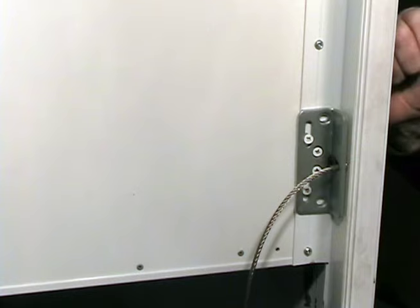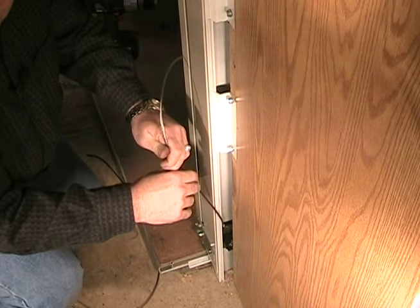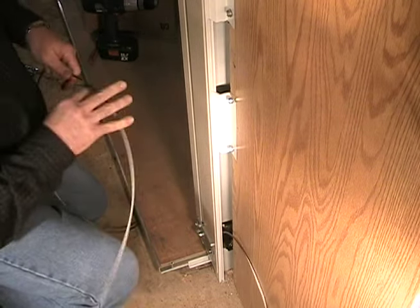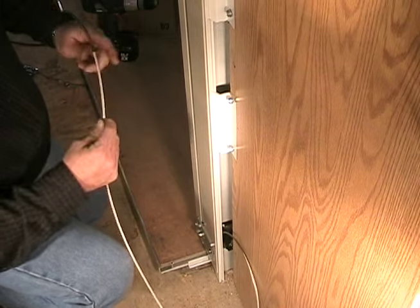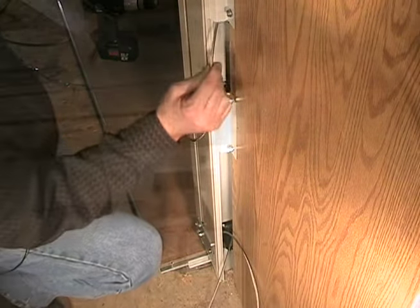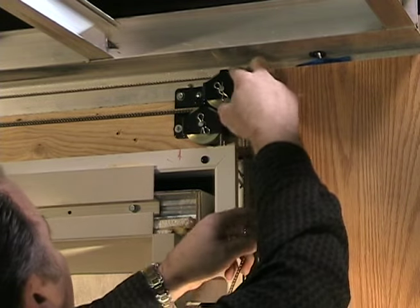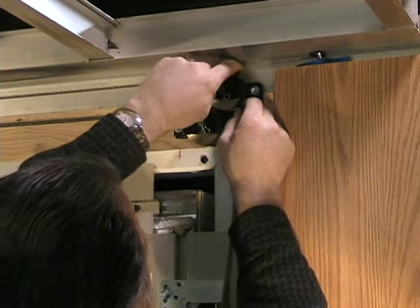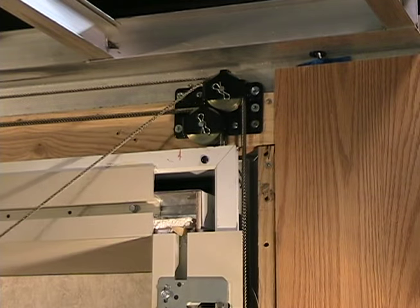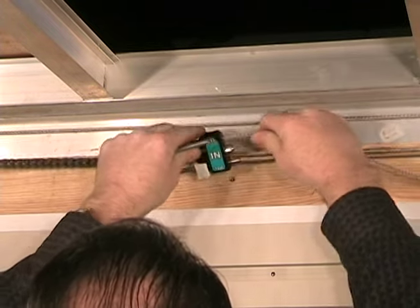Now I'm ready to go inside the coach and pull the cable through. Pull the cable until it's nice and snug because it's already in the bracket outside, so you know it's hooked to the room. At this point in most coaches, you would not have the jam clamp attached like this — it would be one piece that you'd remove before you got to this process. Then simply take the end, run it up through the corner pulley under the tangs, and pull the cable tight. At this point, you'll remove the old cable — it will pull straight through the bracket.